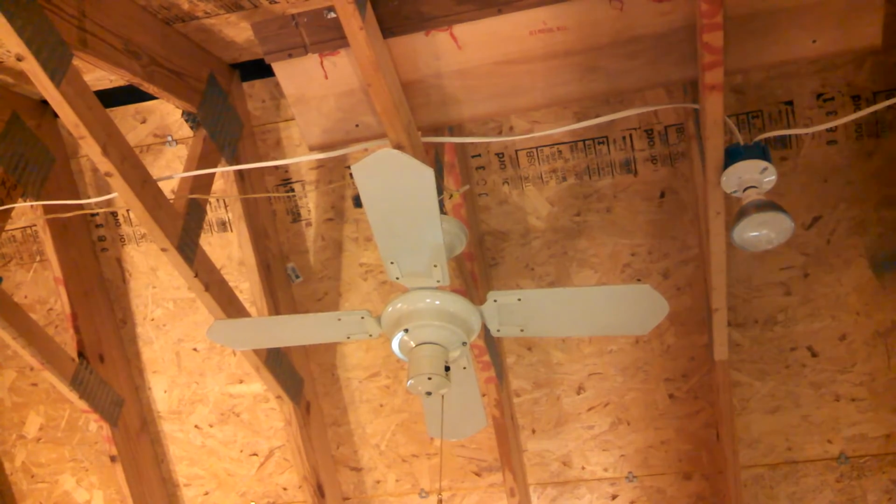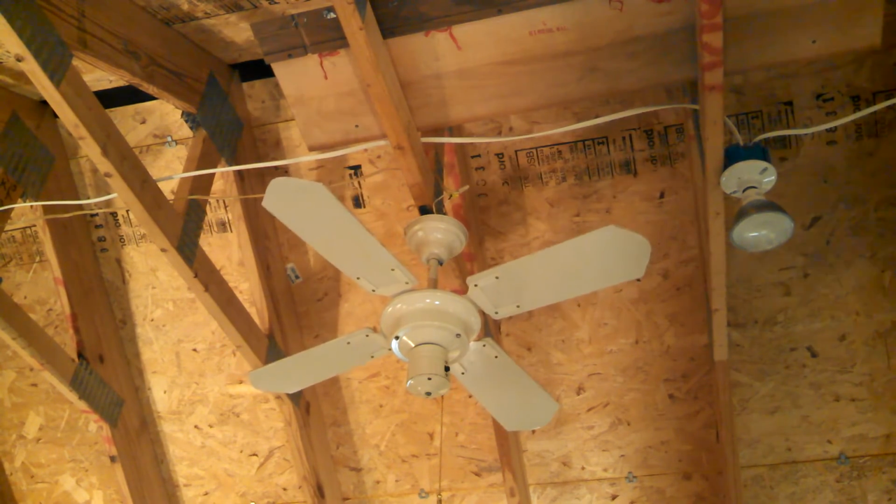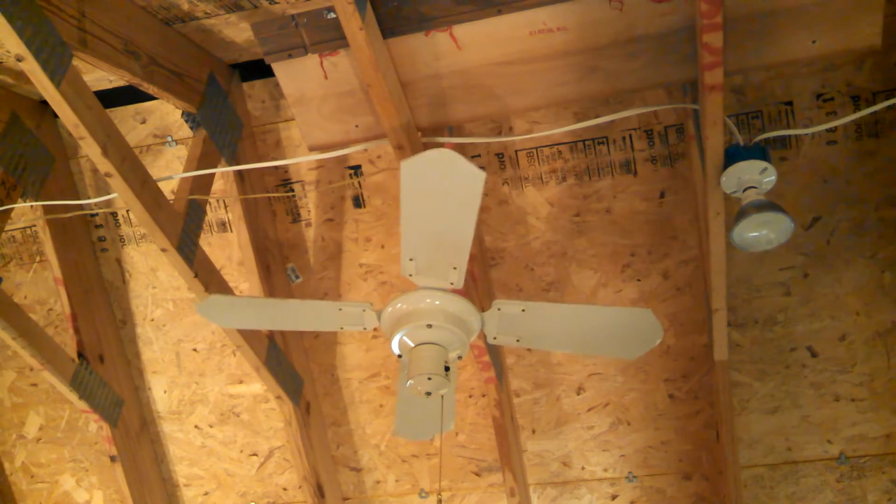Okay, let's inch up the control. 0.06, 0.07, 0.08, 0.09, 0.1, 0.11, 0.12, 0.13, 0.14, 0.15, 0.16, 0.17, there we go, 0.17 is the magic number, which is just under the 0.19 where the 4 microfarad gave us.